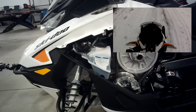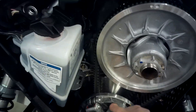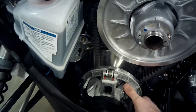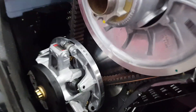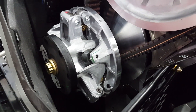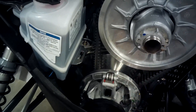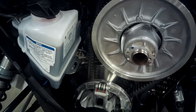If I am over, I can do a quick adjustment with the clickers on the P-Drive clutch here. They've got a clicker adjustment position that increases or decreases my RPM by 200. Depending where I go, it's all numbered. We're set on number three right now. If we drop down to two or one, it'll decrease by 200 RPM every position. And same thing, three or four, it'll increase the positioning. Basically what it does is it just changes the ramp profile against the roller to allow your clutch to have a little different shift characteristic.